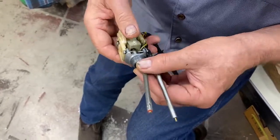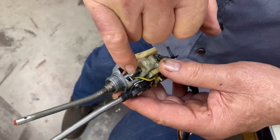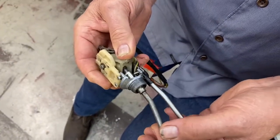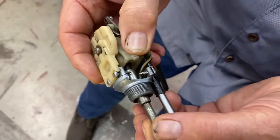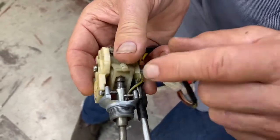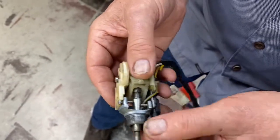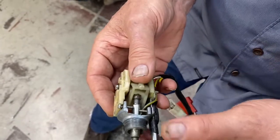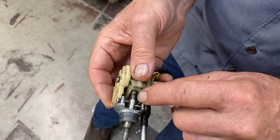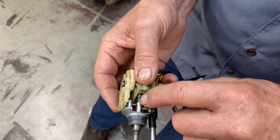What typically goes wrong with these is this piston that slides in and out of this sleeve. As I wiggle this, we can see that the piston itself is loose in the tube, and it's also hitting these screws, which are incorrect — it's actually physically touching those screws, which is not a good thing. We need to replace them with the correct threaded screws. In any case, what we generally do is either resleeve this or make an accommodation so that the piston slides concentrically in and out of this hole.